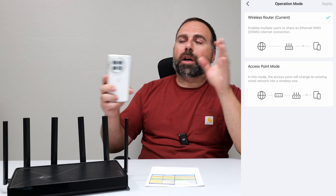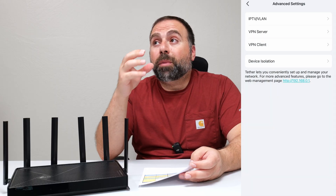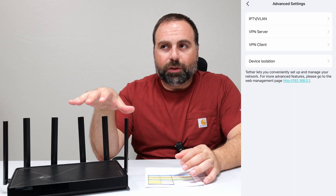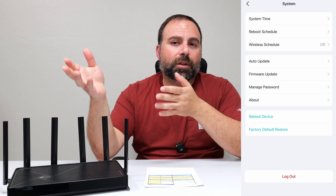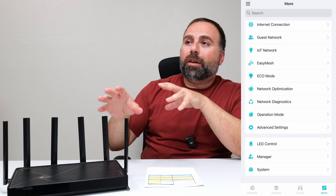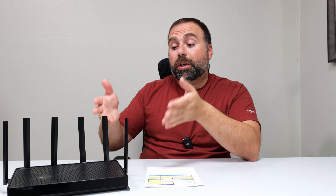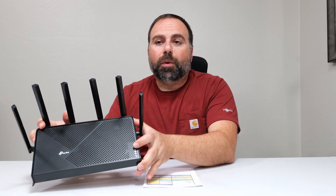I prefer MLO more for wireless backhaul in mesh systems like the Deco. You can also make a guest network with 2.4, 5, and 6 GHz options, and a separate IoT (Internet of Things) Wi-Fi network with its own 2.4 and 5 GHz bands for smart home devices like security cameras. This router supports Easy Mesh, so you can pair it with another Easy Mesh compatible router to create a mesh network. VPN setup is also available, along with more advanced controls at 192.168.0.1. There's also a Wi-Fi scheduler to turn Wi-Fi on or off during specific times of day, plus firmware upgrades and LED control all within the Tether app.